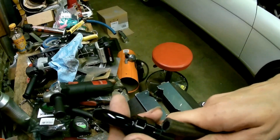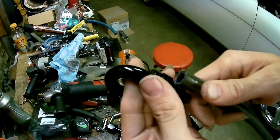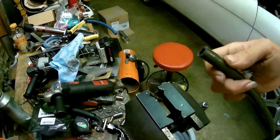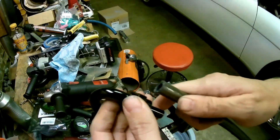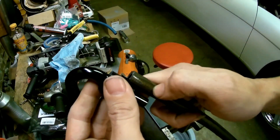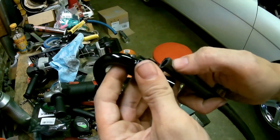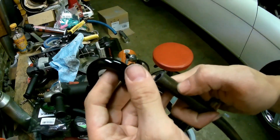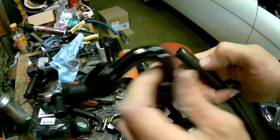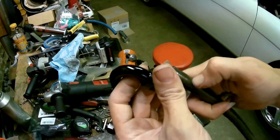The clamping is right around there. That's where it's gonna clamp. I usually go up to basically the mating surface of the actual nut that goes on here. I'll go up to there and cut this back right here. I know I'm gonna eventually strip this back and I'll end up with this much hose in there. If there's a little bit of stainless showing, I don't care — as long as the rest of it's fine.